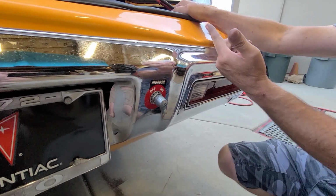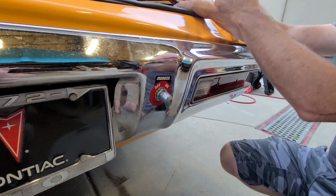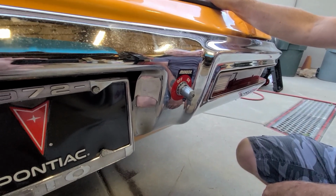The reason you want to check that is if your system is not wired correctly, or the chargeback wire is in the cluster feed, it will feed back. So if you get the field excited on the alternator and you have the fan running and you hit the switch and the car doesn't shut off, you can be in a world of hurt.